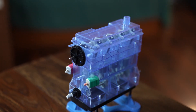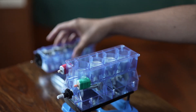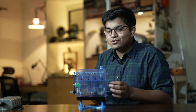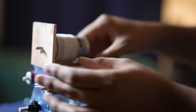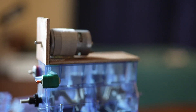So this is what we came up with. Instead of removing the whole engine, we only removed the top half — called the cylinder head — and we removed the pistons, because we didn't really need those anymore. While leaving in the lower half of the engine does add weight, it makes our job much simpler. All we have to do now is make one simple L-shaped motor mount to mount our motor atop the remaining engine block. Now we can power the AC compressor, the power steering pump, and the wheels of the car with just one motor and one motor controller.